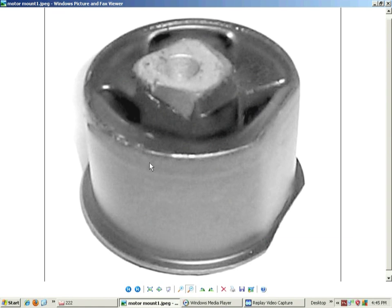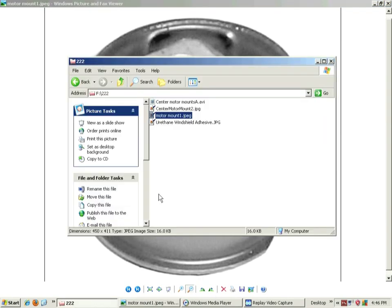Now something else, you notice you can buy the inserts, and you would hammer this whole insert into the cradle itself after you take out the old insert. And they're pretty difficult to get out. You have to use a 3-pound hammer. What a lot of times I'll do on that cradle itself where this goes in, I'll file the edge of the metal so there's a little bit of a taper going inward, and that helps to start this a lot easier. That's a little trick too.